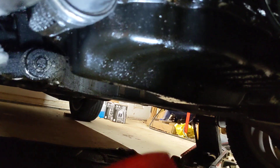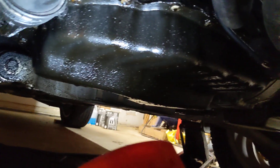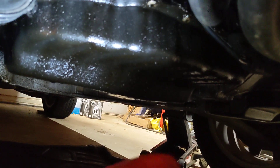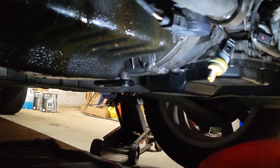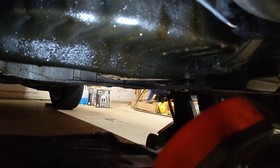What I think is going on is the valve cover leak is coming down, causing all this oil to accumulate. Even over here, this turbo intake thing just has a ton of oil on it — it's blowing back and hitting the suspension pieces and the rubber on the suspension pieces. This oil is mainly concentrated on where the engine is, front and back side. I'm assuming a lot of that is really due to that valve cover leak and possibly a timing cover leak also. So I'm hoping I'm going to get away without pulling the transmission out and doing the rear main seal on this one. There were no codes on this motor.